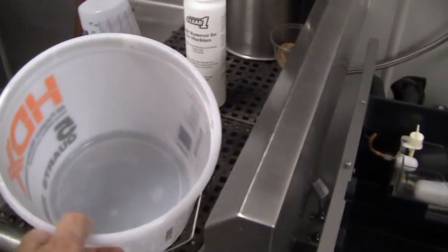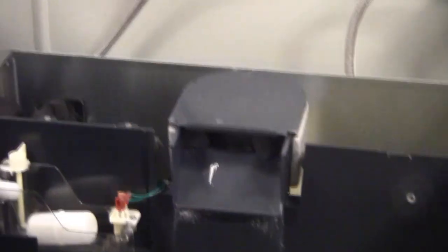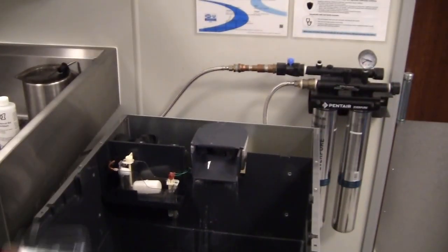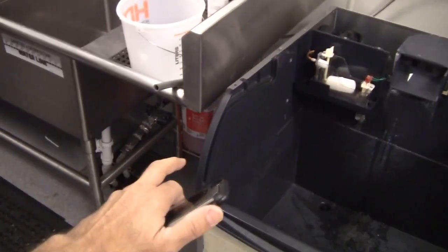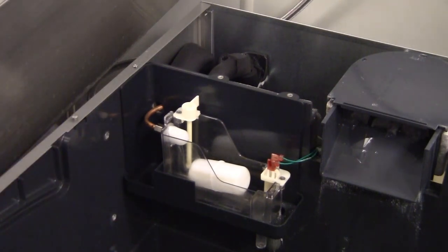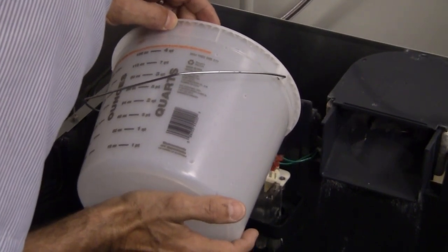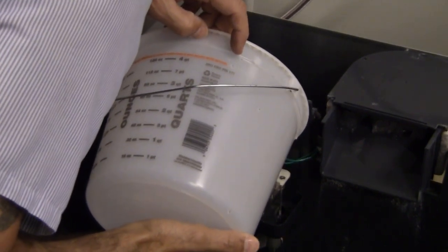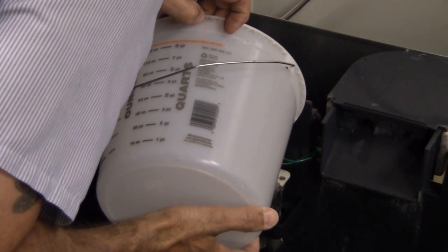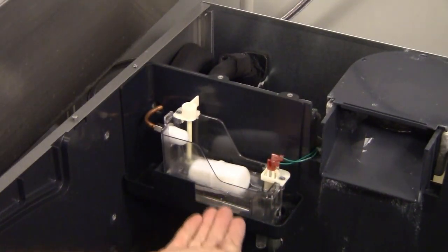It's been 24 minutes and you can see we are just starting to make ice for the first time — you can see it spilling out into the tray below. For the last 20 minutes I put the back panels on and I'm going to hook up the drain line right now so when I clean out the bin it all goes down the drain. I can see the reservoir is empty — I'll put this remaining solution mix in and fill up the reservoir so we can keep making this cleaning ice.